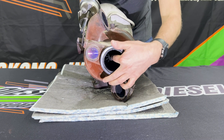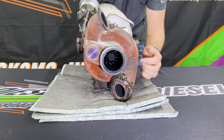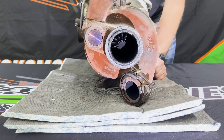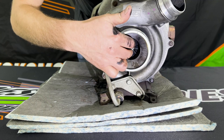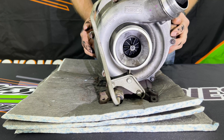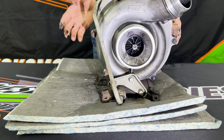I'm going to turn this thing around — you can actually see that one of the pieces of the wheel is missing and broke off, probably due to that bearing going out. You can hear it. The play — and obviously as it got play it probably smacked the housing, and then you're going to see that piece of the wheel break off. Luckily it went to the exhaust side. But if the compressor side were to ever shear, you guys would know, because if it breaks we've got bigger problems — you could have pieces of shrapnel in your intercooler piping, and then you're going to be wanting to replace your intercooler and get your piping all apart and clean it as well. Luckily this one isn't on the compressor side, it's on the exhaust side, so there's really nothing to worry about.